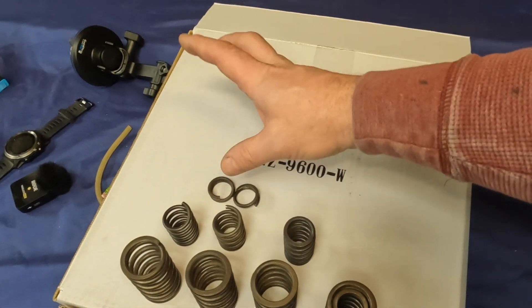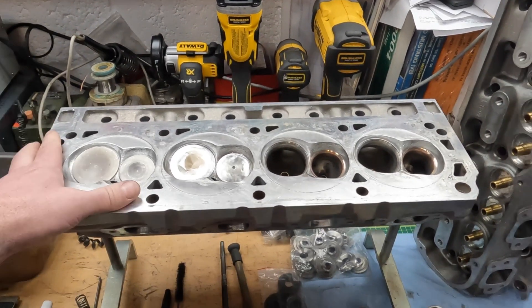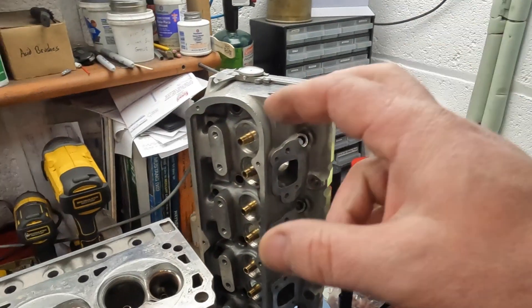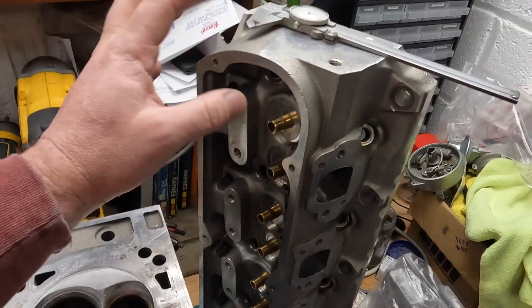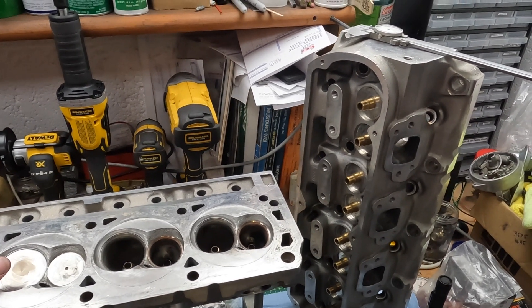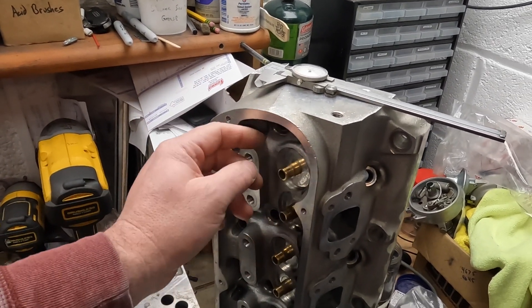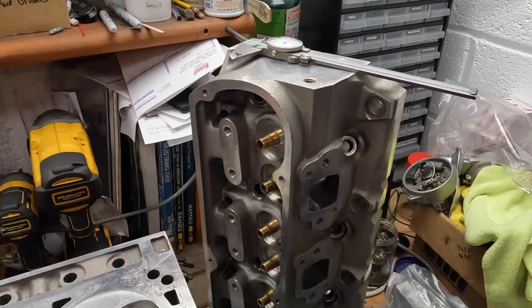This is a normal occurrence especially with a double spring setup. This engine — one of these heads — was on a stroker Windsor with a TFS Stage 3 cam, 1.7 ratio Trick Flow rockers. Not all that crazy, but obviously enough to break some springs. Delving deeper after I took it all apart: these heads are originally for serious race or Fox Body racers back in the day, and they're primarily built for solid roller camshafts, which need a major spring. These springs are about 1.950 installed height.